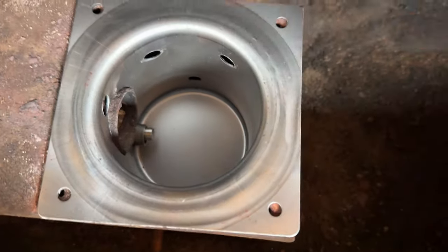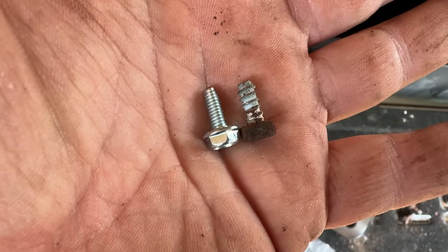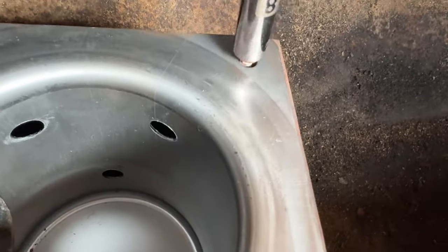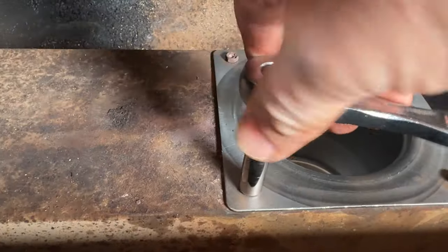Your igniter needs to be out about an eighth of an inch or a little more. We found that we're going to have to stay with the original screws because the ones sent with the new pot just didn't fit the Pit Boss. Be careful — you're going to use the screws that came with your Pit Boss originally, so they're going to be old and fire-hardened. Don't put a lot of torque on them or you'll break them off and have to drill them out. Give it a nice little turn — one half turn after snug and you should be good to go.